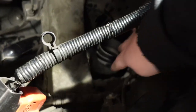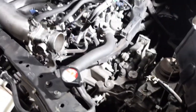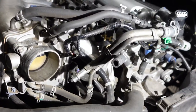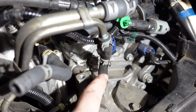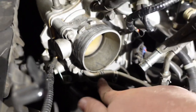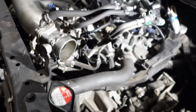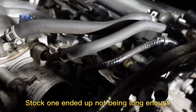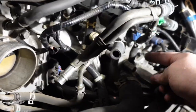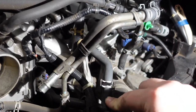So you are going to have to pull the wheel off, jack it up, pull back the fender liner, and pull out the side of the bumper here — really annoying. Next up you want to drain your coolant. This coolant line here follows down right to the throttle body. We're going to use the little hose from the kit for that connection. The stock hose is going to actually go into the intake, and the big one is going to be in the same spot.